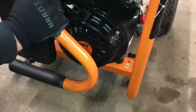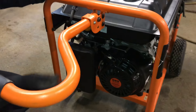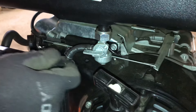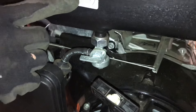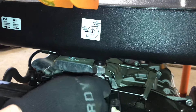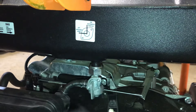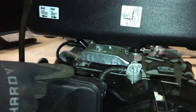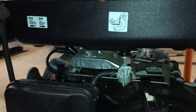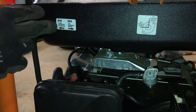This is the handle. These handles actually have little buttons on them — this guy here will pop up and lock in. You have your inline fuel shut off. Usually when it's straight up and down — you go by the diagram here — straight up and down should be on, and then off is to the right. So we have to turn it on of course. Then you have your choke, which is kept in the off position, and then choke up here shows choke is this way, so that would be on.